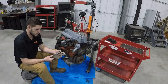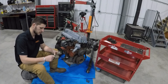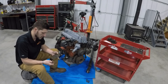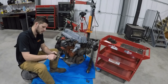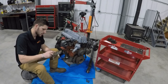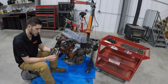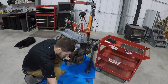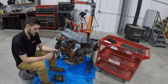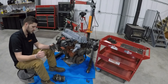The next step is to get out your AC adapter block and assemble it. Put your 8mm bolts through the back side and start those into the other brackets — just leave them hand tight for now, not tightening with an impact. There's just enough play that the brackets can move a little bit. Rather than adding the extra expense of milling a slot in the base plate to line the brackets up, we're going to use the AC compressor itself to line things up.